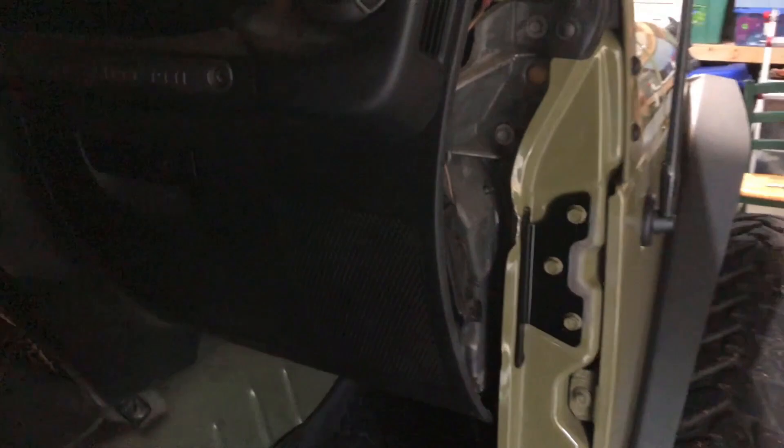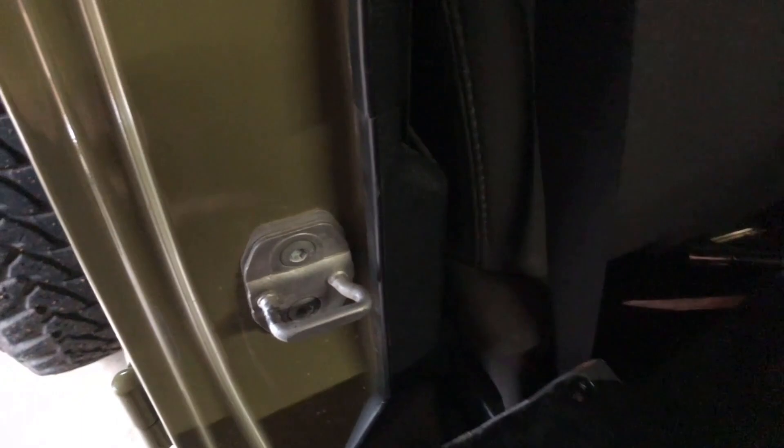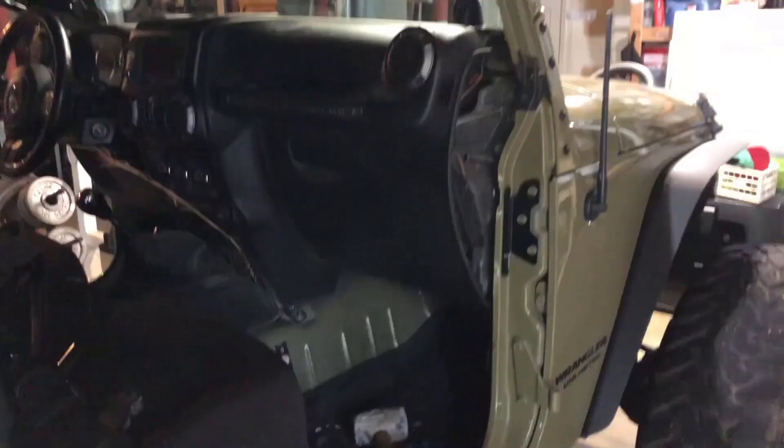The passenger side had really weird fitment — I had to pull it back, and we noticed it was making contact right here. I need to grind down the casting a little bit. Interestingly, the previous shop that installed this cage had ground down on the back side of this same spot too, so it looks like they had the same fitment trouble — which makes me feel better.